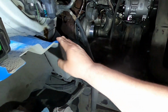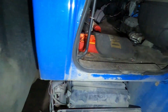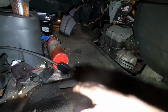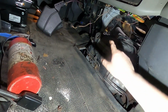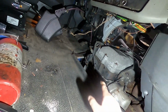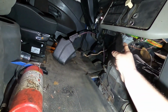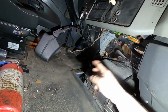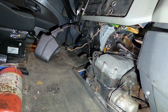Some people take this off the rear fender, but I had the seat off before. The seat was just 4 bolts. The doghouse was about 1, 2, 3, 4. You lift this up, there's a couple more bolts here. I took the shifter housing off, not too bad, just 2 bolts. The throttle, I unbolted, then bolted back just so it wouldn't be in the way.